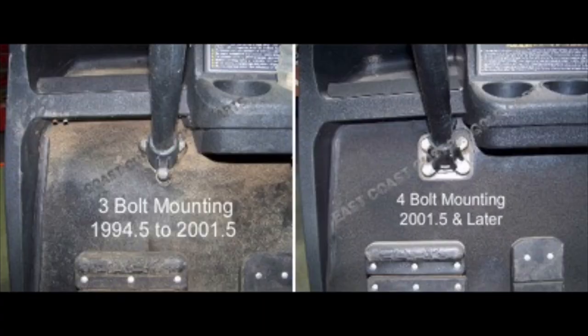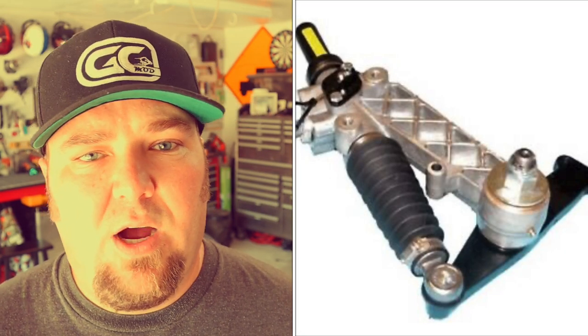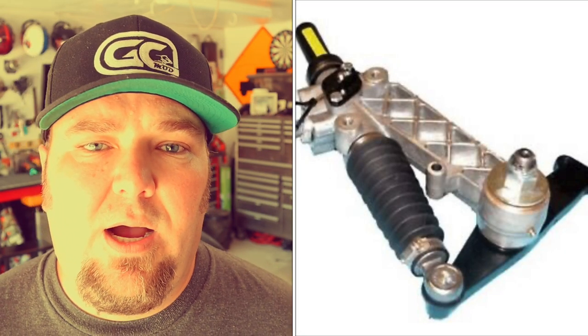Here's another lingo term you're going to hear a lot: does it have three-bolt steering or four-bolt steering? If you have a three-bolt steering cart, that is an older cart. The best way to tell is to look at the bottom of your steering column — there are going to be three bolts on the floorboard. That goes to a big steering arm, and then you've got rod ends that push the tires in and out. It's an older way; there's nothing wrong with those carts, but they're a little harder to steer.